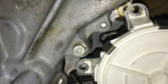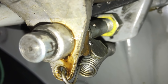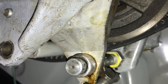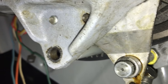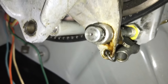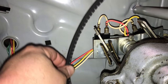Part I was trying to figure out, because the instruction sheet didn't tell me to do so, is that the clutch spring right here has to be disconnected. Then the clutch yoke, which is this plate here, separates from the clutch shaft, which is this, and that is oil on there. I'm going to put another drop or two on and make sure it's still oiled so it slides up and down, because that's separate from the transmission. But when it's all apart, it should separate just enough to where the belt will slip out through there. That was the part I was trying hard to figure out what they were trying to show me.